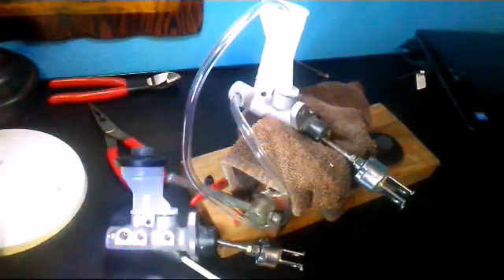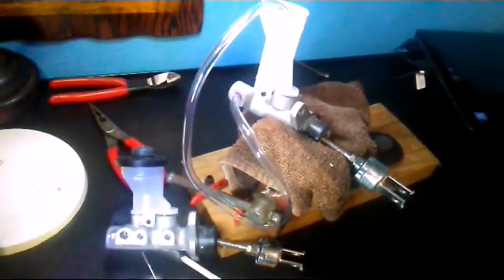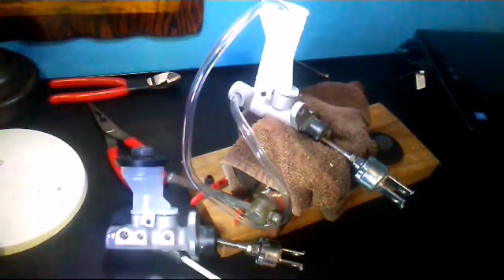What's up YouTube. I got two master cylinders — one for the clutch and one for the brakes. I'll show you what to look for when you order a master cylinder so you get the right one the first time. This one here is going to be a brake master cylinder because it has more hookups for lines — right there, right there, and right there — whereas the clutch master cylinder is just going to have the one.